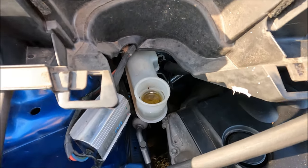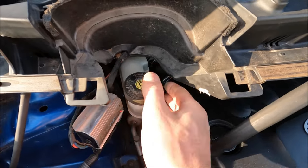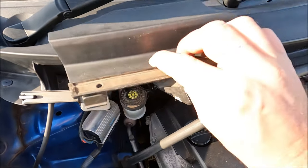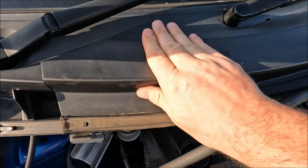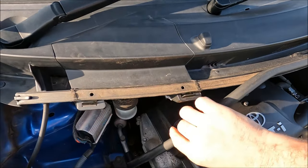You can see our brake fluid level there. As I say, this takes DOT 4 brake fluid, so make sure you put the right stuff in. I would recommend you always stick with the same brand if you've topped it up previously, and always make sure this cover goes back on and you replace your trim.